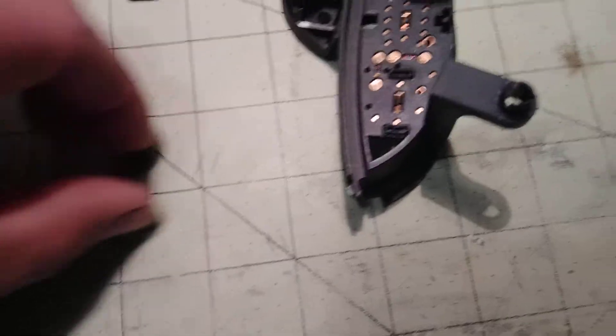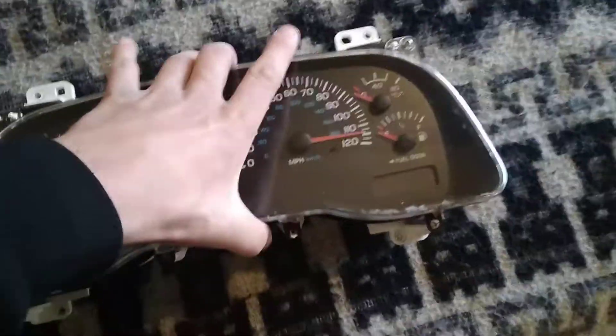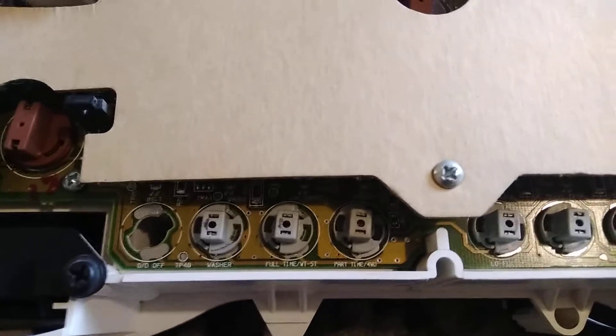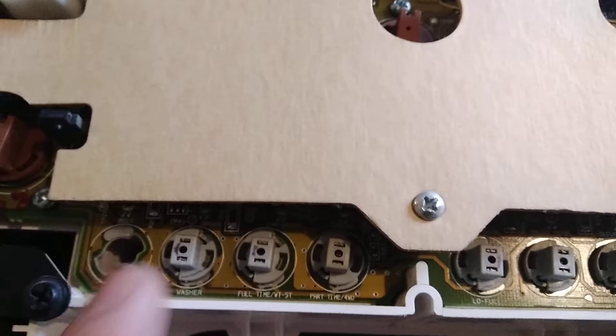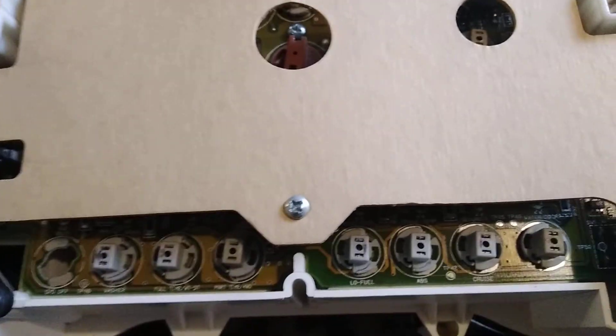I'm trying to troubleshoot my cruise control. The switch was good. What ended up happening is I cleaned all this out — I took the lens off and used a paint brush and a sponge to clean the gauge cluster out; it was really dusty. The cruise light was burned out, so I swapped it with the overdrive-off bulb because my truck's a manual. I'm going to Napa to pick up some of these lights — some of them are burned out.